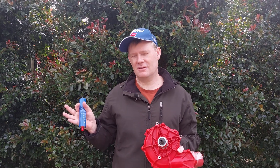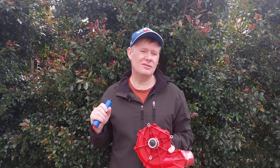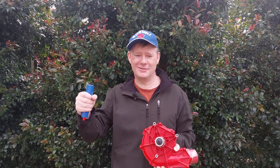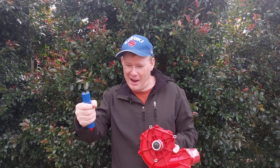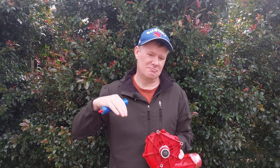Because it's an electric supercharger, the boost is not relative to engine RPM at all. That means if I'm getting 3 PSI at redline, I should be getting a lot more lower down in the rev range. I'm actually really concerned about getting decent boost between 3,000–5,000 RPM, because that's where you drive — you don't drop the kids off at redline. So if I get 7 PSI at 3,000–4,000 RPM, I'll be super happy.